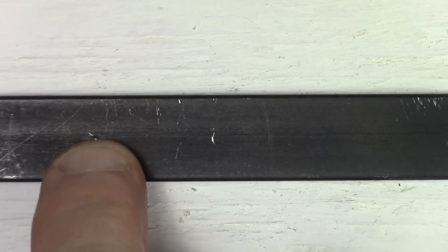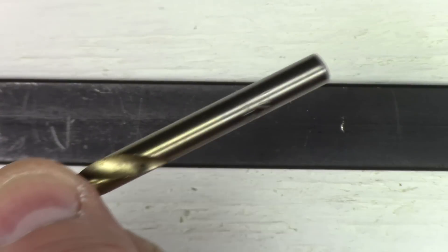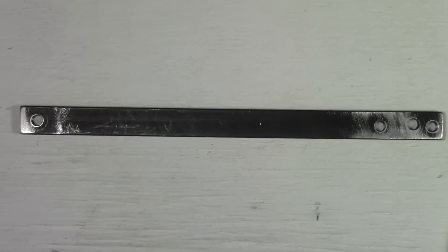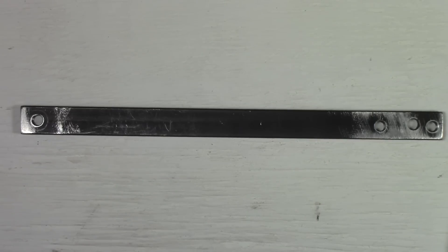When you're drilling this by hand, start with a very small drill — I'll do the same on my drill press just to figure out how deep I need to go — and then work your way bigger and bigger until you get through to the size you need, which is 7/32nds. You're also going to need tap and die tools. I'm going to be using my drill press as the tapping tool for making the threads.